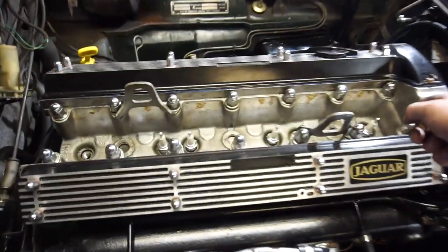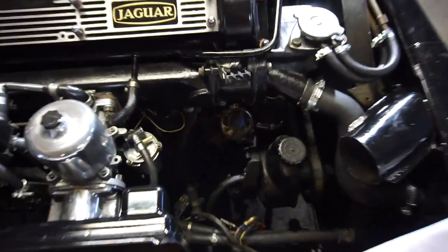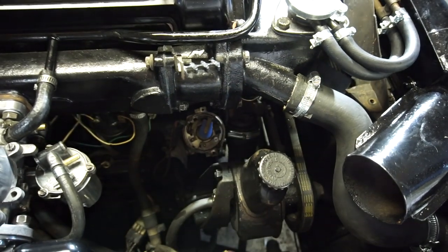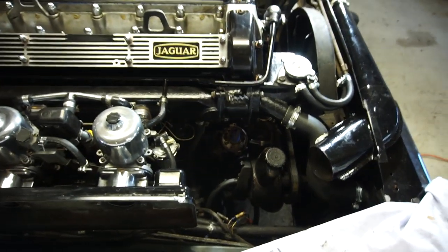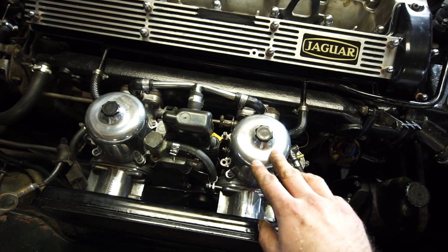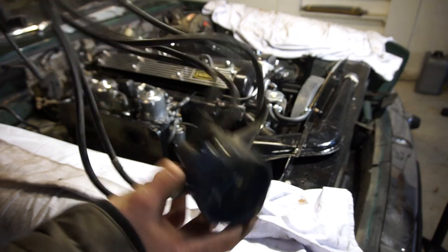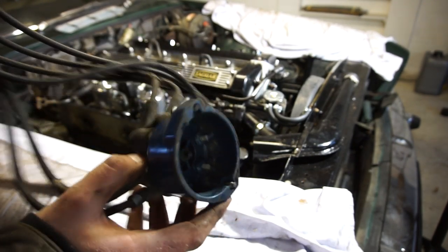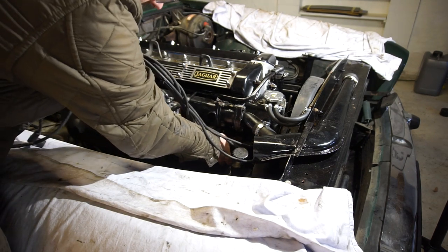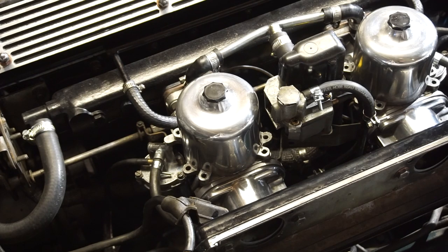Now I'm putting the spark plugs back in. Once they're all in and tightened down, I can put the distributor cap back on along with all the plug leads. I set the timing exactly — I rotated the engine to 8 degrees before top dead center, which should be correct. I'll check it later with a timing light, but it should fire off. I'm putting back the old cap and old leads for now; they did run before and I've cleaned them up a bit. I do have a new set on order, and they'll be a good surprise coming up.